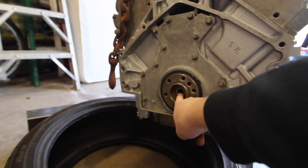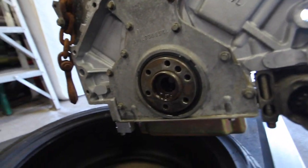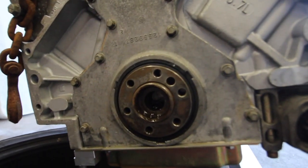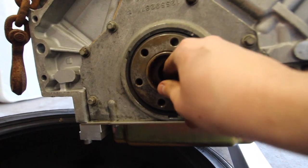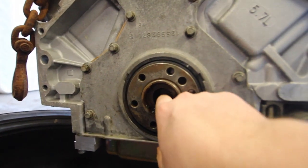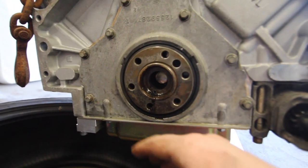Now what I have to do is pull out this pilot bearing — I have a puller right there. Got the pilot bearing out, now we need to put the new one in, but I absolutely destroyed this one — check it out. I took the sliding hammer and used it in there. All the needle bearings just fell out — all the little bits are in here. Just tiny bits of metal everywhere. I've got to clean all that out and then we'll put the new pilot bearing in.